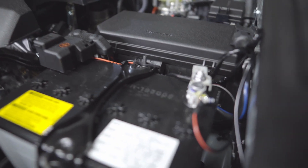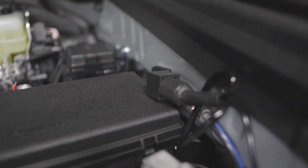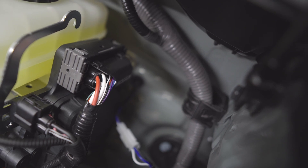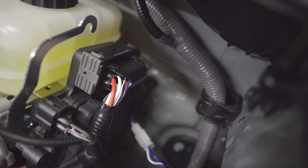I've connected the DT connector to our Auxito LED Q16. Make sure they are at the 12 o'clock position. Now for the dual high beam setup — I temporarily placed the harness here and I'll use an L-bracket to secure the relay. Wire up positive and negative, then rerun the cable through the grommet — there's a small grommet over here, just cut it out and pass the wiring through to the inside of the car.